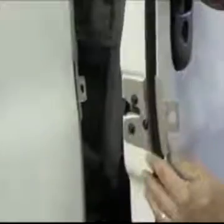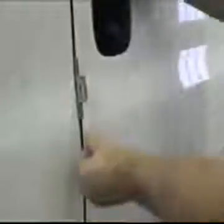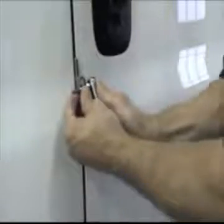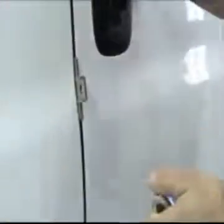Close door slowly, making sure weather stripping doesn't grab in between brackets. If clearances are acceptable, shut door firmly and align lock mounting holes. Open door gently and finish tightening the bolts. Close door firmly and install puck lock. For greater security, always use a SlickLocks spinner on your puck lock.